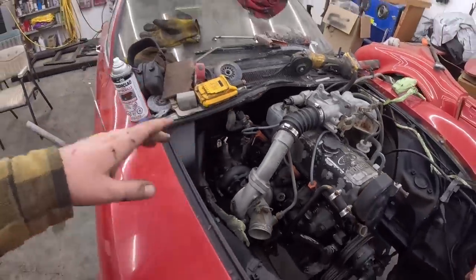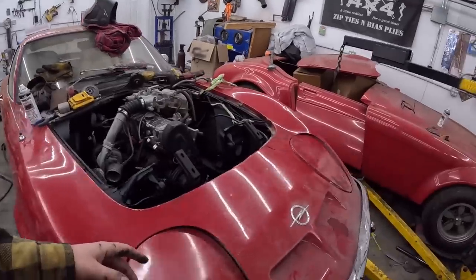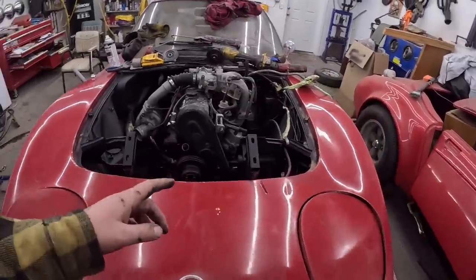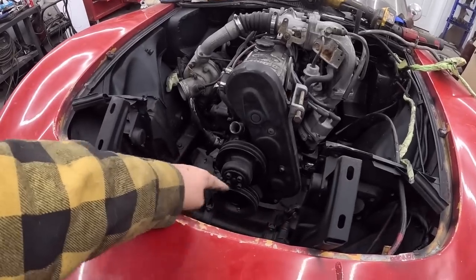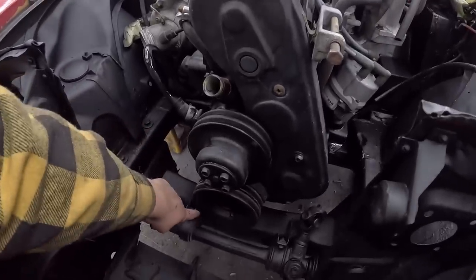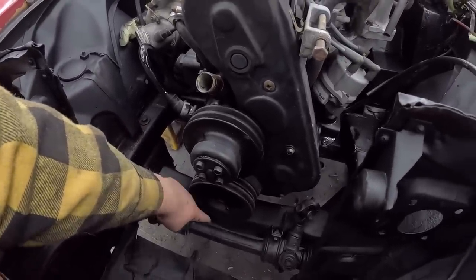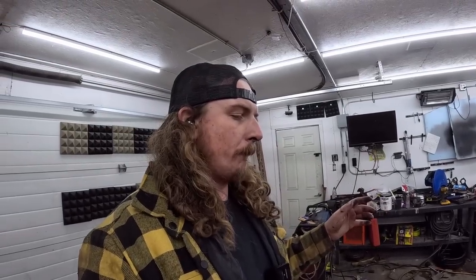That'll be fine. I think this thing is a two-piece drive shaft, so we're going to have to get a one-piece made. I think we've got to lift it up just a little bit. It's kind of funny on the mounts. I can fit one finger between the pulley and the crossmember, and I've got to do a little more trimming right there. She's not touching, but close. We'll see how rattly this thing is. Ultimately, solid motor mounts may be the way to go, but we can figure something out from there.